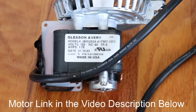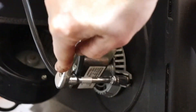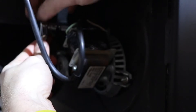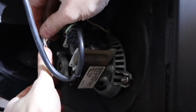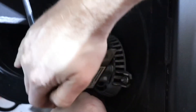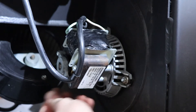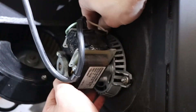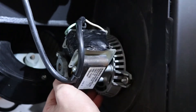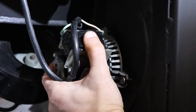Here's a quick look at the replacement motor — I'll leave a link for this one in the description below. Next you want to remove the motor, so you can take your ratchet and socket and extension and loosen the three nuts that hold on the motor, then totally remove them.